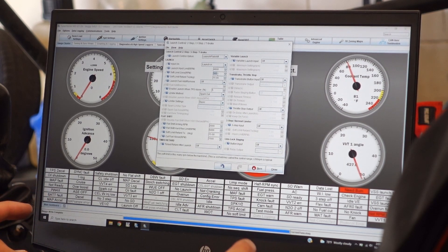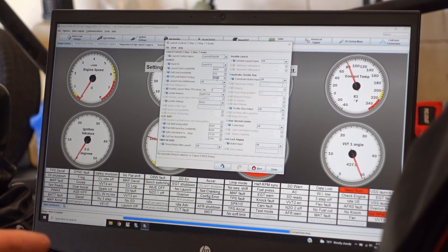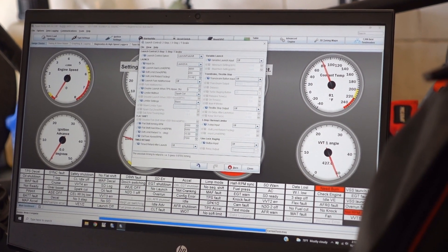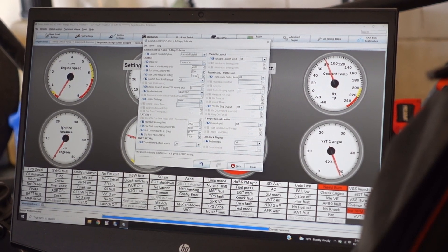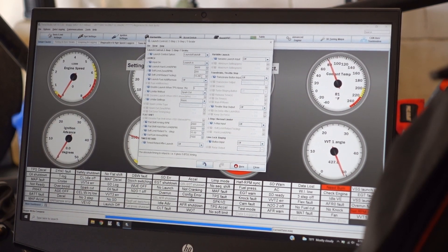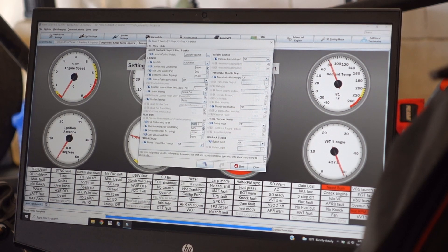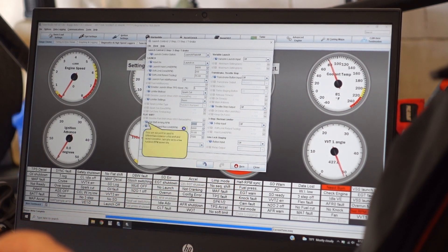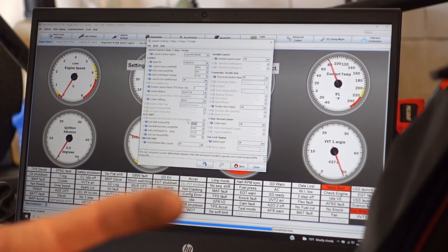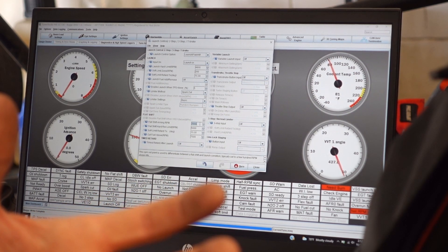The soft limit zone is where it limits below that. Mine's going to be set to 200, which means that this will pull ignition at 4,600 RPM. I've got my soft limit set to 15 degrees — that's not super aggressive. Now, once you get under about 5 degrees, that's when you're going to start throwing flames because now you're igniting that exhaust as it travels into your turbo. I don't need any of that to build boost pressure. For me, 15 degrees works fine, and that's just a little less violence on my turbo. Now my flat shift arming — for me, I'm never going to be flat shifting under 2,000 RPM. If I'm flat shifting, it's going to be probably in the 4,000 to 6,000 RPM range. So anything over 2,000 is plenty safe. That's when our flat shift will be armed.